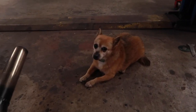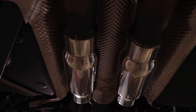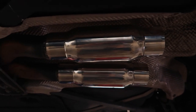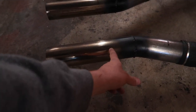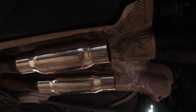Me and my dog Milkta just went ahead and dropped this rear section of the exhaust after I cut it. And I went ahead and test fitted these resonators up here and they could not be a better fit. These are the Vibrant Performance Bottle Style 12-inch resonators — they're 12 inches long from end to end. You could probably make them shorter by trimming the ends, but they are perfect for my situation and a perfect fit. So next I got to go ahead and trim these straight pipes down and then just do back and forth test fitting until the fitment is exactly where I want it.